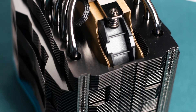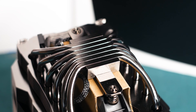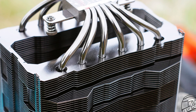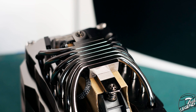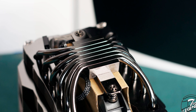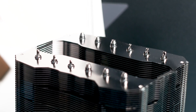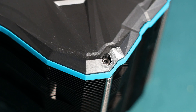To transfer and dissipate heat from the CPU, the Ice Slit G6 Stealth uses no less than 6 nickel-plated copper heatpipes, each with an outer diameter of 6mm. Unlike other CPU coolers such as the Noctua NH-D15S, the heatpipes are integrated directly into the base plate — a design called Direct Touch, which has been around for years. The Ice Slit G6 Stealth is one of the few flagship CPU coolers using such a base plate, as most others use a solid copper plate for better thermal transfer. The heatpipe endings are asymmetrical, though this makes no difference as the top is covered by the plastic mounting plate.